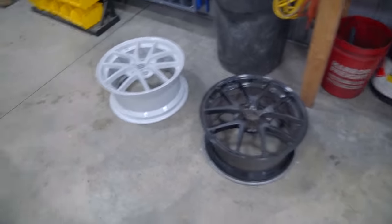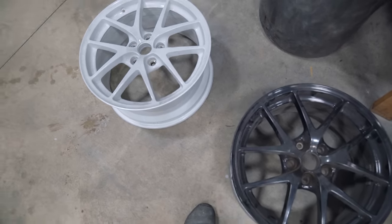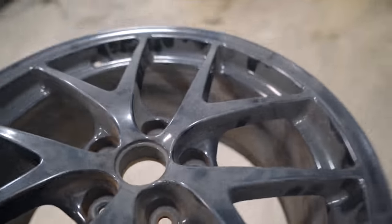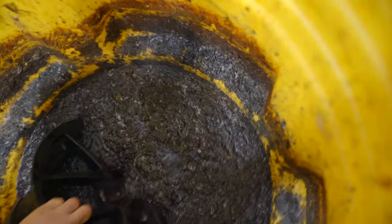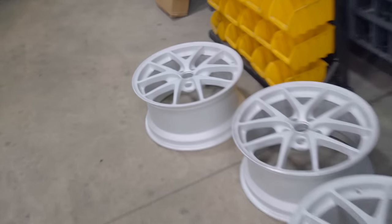So the next step in the wheel repair process is the chemical strip tank. If you guys are an OG subscriber, you already know that is the powder coat strip tank. So it goes in looking like that and it comes out looking like that. All four wheels are completely stripped.